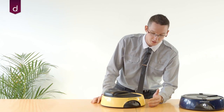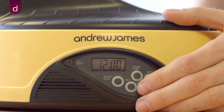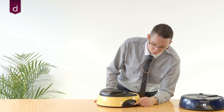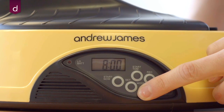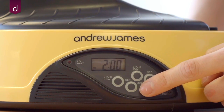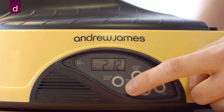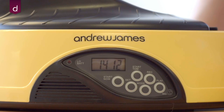That's completed a full cycle, so what we need to do now is set the time. On the screen we can see it displays 12:00. If we hold the set button for two seconds, the 12 now starts to flash, so we can set the hours. Press the mode button to cycle through an hour at a time. It's initially set to a 12-hour clock, and when we go past 12 a small PM will be displayed in the corner. If we want to change to 24-hour, set the hour you want, press the set button, then press mode again to cycle through the minutes. Find the minutes you want, press set, and the time will flash altogether. Press mode once more and it'll stop flashing — it will have changed the timer to a 24-hour clock.